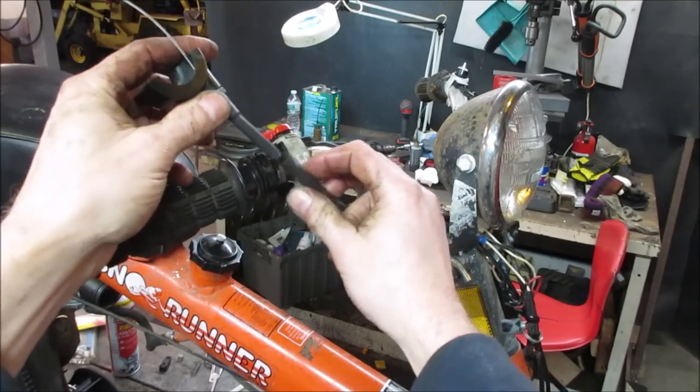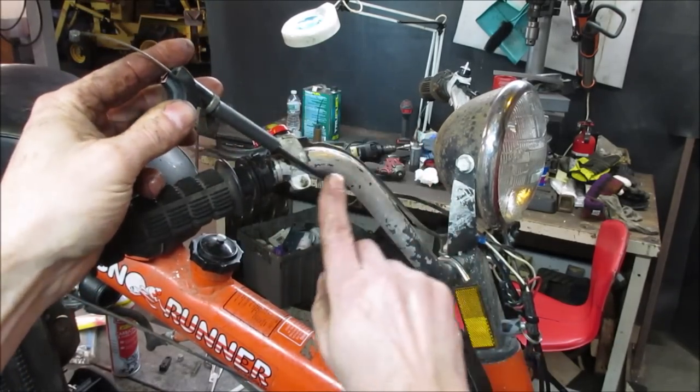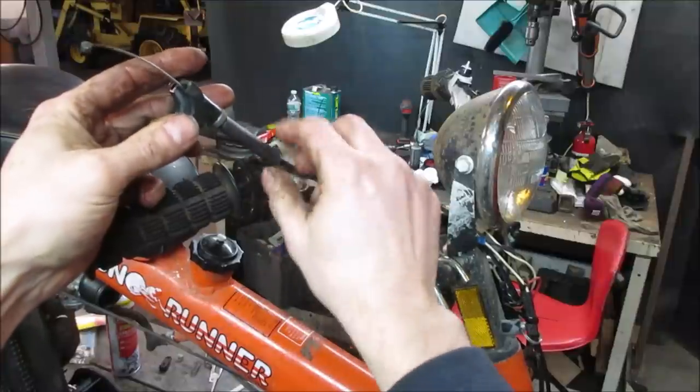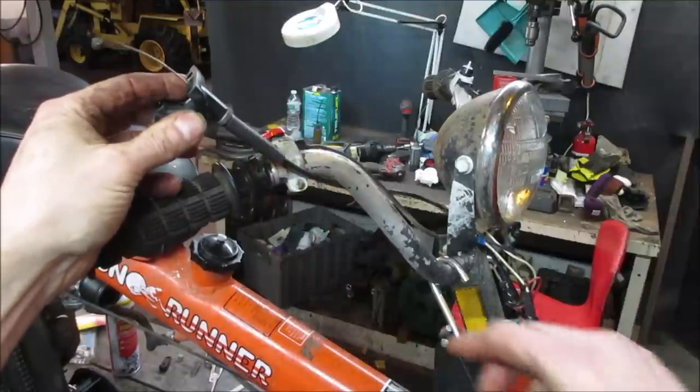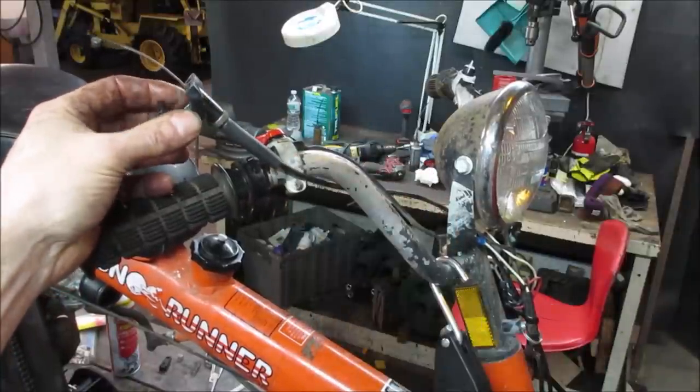It's also good, like I was talking about, if you got a piece of cable that's worn bare and you see the metal, like it's got a rub mark and you're down to the metal, you put a piece of this over it and it keeps the weather out, because what happens is water gets in and it rusts the cable to the jacket.